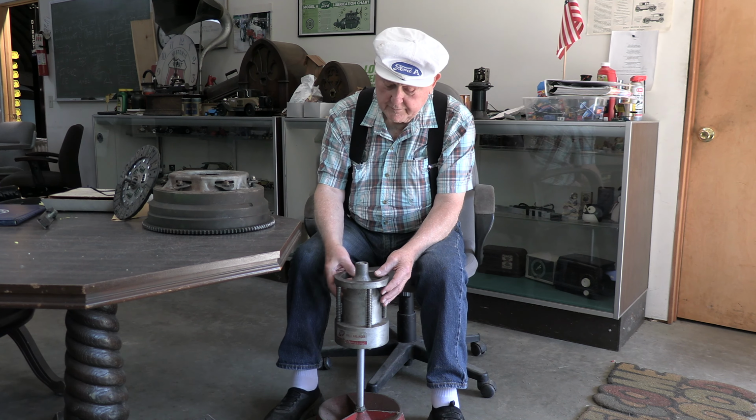But there are probably several other ways that you could balance this. You can hang it, say, from a cherry picker, and then you'd have to be able to center it on your tool. You have to make some kind of a holder that would hold that like a plumb bob, and then you could put the weights on it, then use a level to level it. And there's probably other ways that it can be done, but this is a pretty straightforward way to do it.